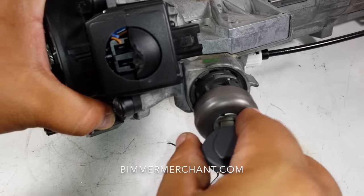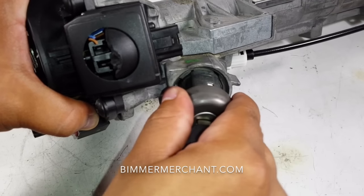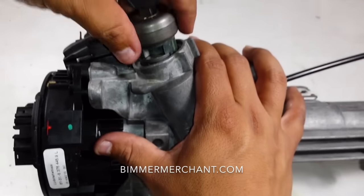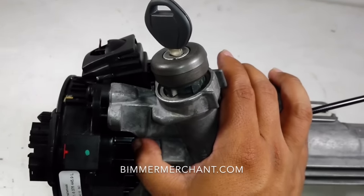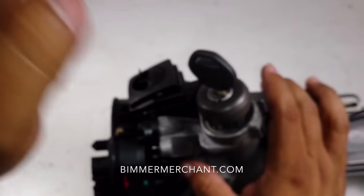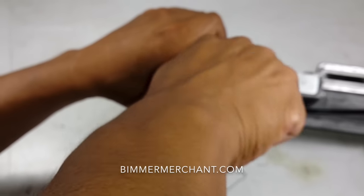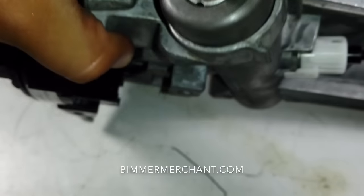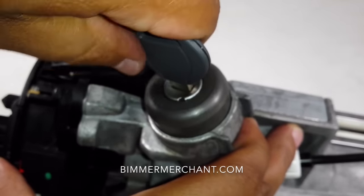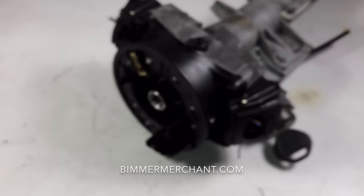Once you're in the position, it's going to slide itself in. See if you can focus — everything is flushed right there. Now with the key in place, just kind of turn it, sliding in. Obviously when the column is in the car it's much better because you don't have to worry about holding it. There you go — it snaps back into place, it's flushed with the column. You can pull the key out and it turns.